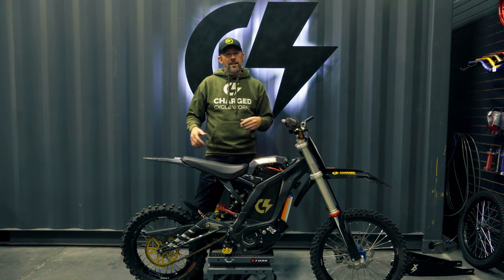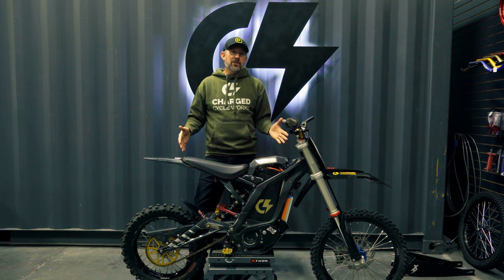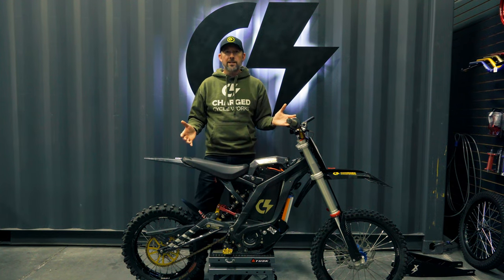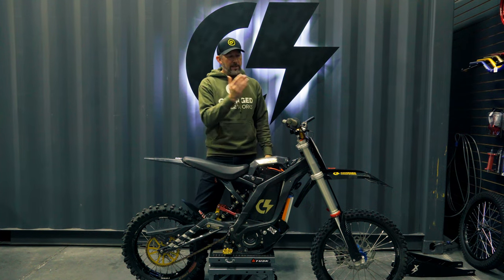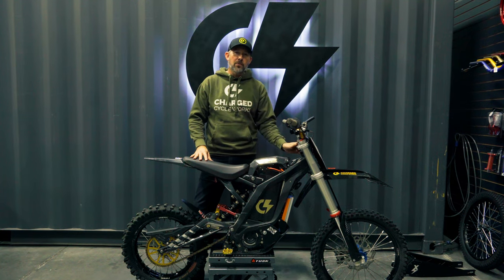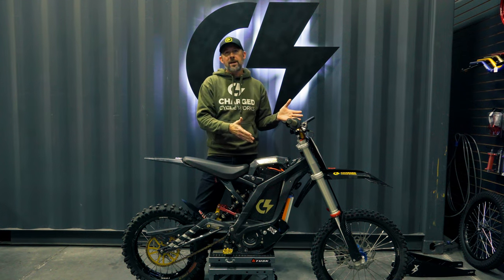The last videos we shot, it was running a Dorado fork up front — both the Expert and the Pro. It had 1821 Gold XL wheels on it, which is very different from where this bike is today. One of the projects we wanted to do this year was an 85 front end. I wanted specifically the KTM front end off the new gen bike because it's an air fork, which means it's a lot lighter than your Yamaha and Kawasaki 85cc forks. So that's what we did to this bike.